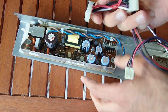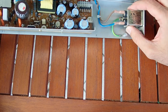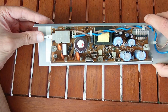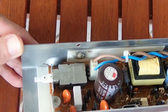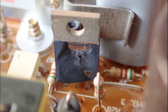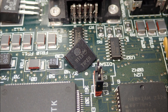Some plastic parts in this computer have become very brittle — trying to pull out the power connector, the holders broke off instantly. The power cable from the PSU is extremely minimalistic. Inside the PSU, the power switch is soldered directly to the PCB. There we can already see that somebody already tried to use this machine with 230 volts — the input resistor blew up and even burned the insulation. The power supply is obviously dead. I located two visually broken parts: the main resistor on the high voltage line, and the regulator which completely lost its face — it is used to regulate the inverter. It must have been quite an explosion because I found the face of the regulator in the other corner of the case.